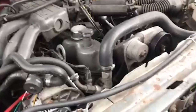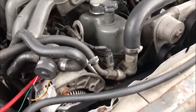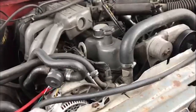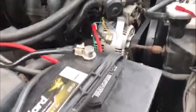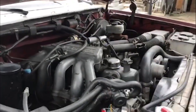I turn on headlights and air conditioning, rev it, and the belt does not squeal - there's enough tension on there to keep it in place. I'm gonna put the fan and fan shroud in here and call it a day. Appreciate y'all watching and I'll see you next time.